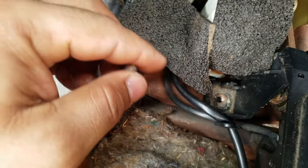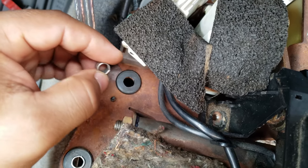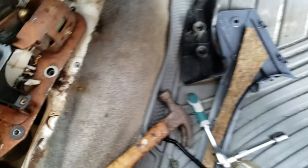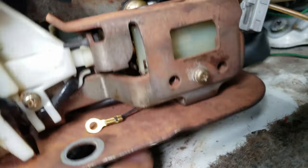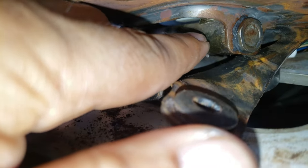I'm going to put the Amazon one at the bottom. On this rubber pad there's a small bushing — you need to punch them out from here. There are four of them: one, two, three, four. When you're done punching that out, look underneath and get that bolt out — there's a nut on the other side, so you slap the nut from the other side and it pulls right out.